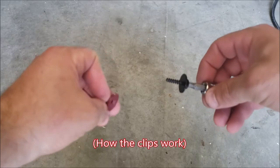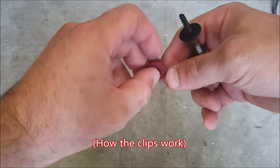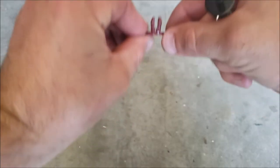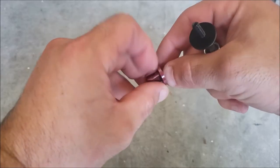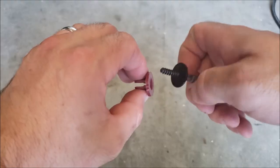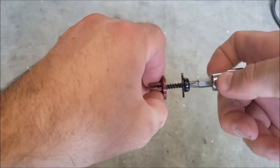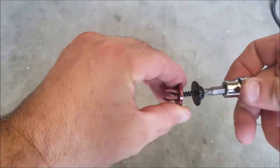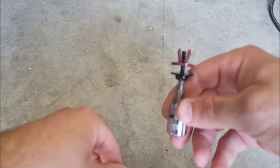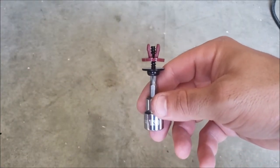Here's a quick demo on how this stuff works. I have a brand new insert here — you can see the two flanges are flared outwards so it will pop in and hold itself there. This actually functions just like a drywall anchor. When your T30 screw is inserted, you can really see those two flanges expand. Look how flared out it is — that will definitely keep it in that square profile in your subframe.